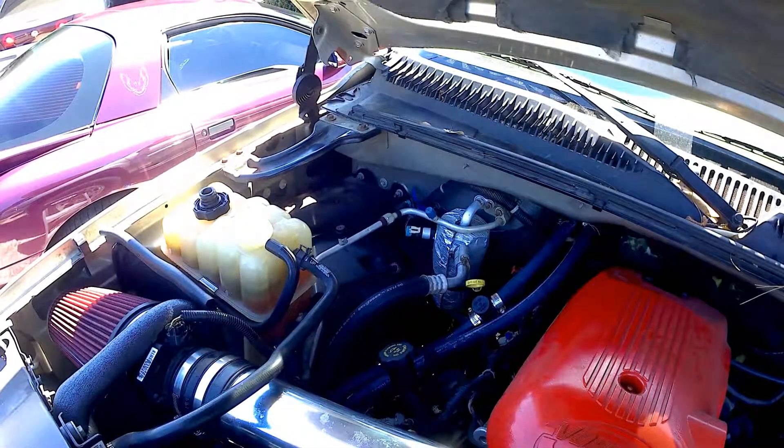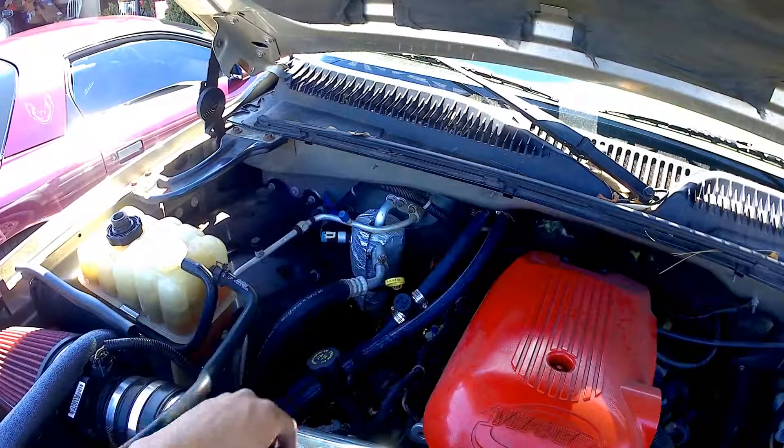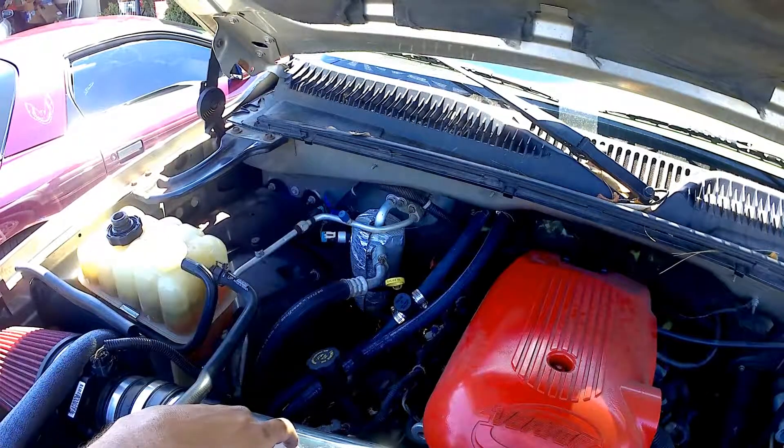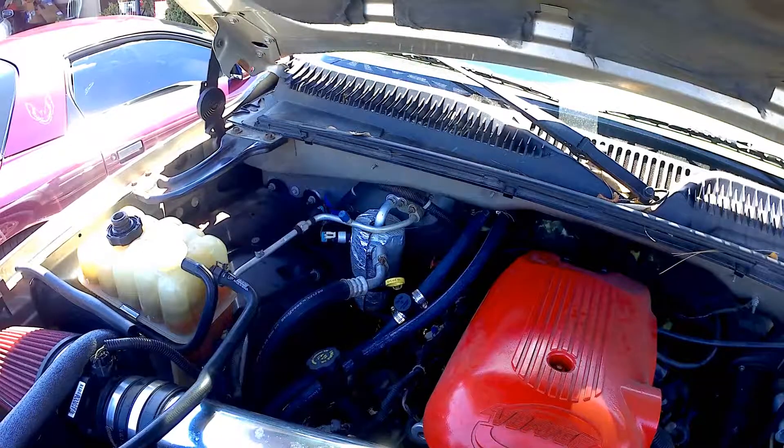Alright everybody, so far it seems to be well. We'll drive it on Monday for work and see what it does. That's an easy way to fix potential heater core issues — more than likely it's not the heater core, it's just the plastic connection. A really easy fix, typically under an hour. Thanks for watching The Combustion Guy — we'll see you next time. Don't forget to like the video, and if you're not subscribed, go ahead and think about hitting that subscribe button. Thanks for watching.